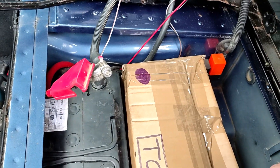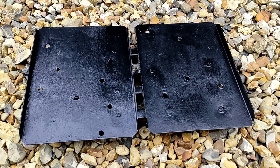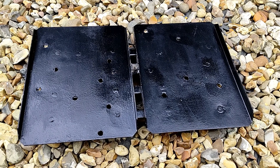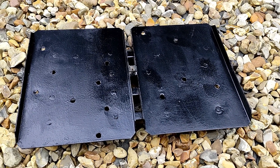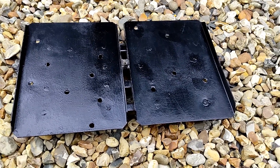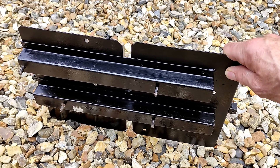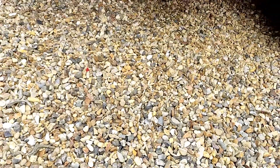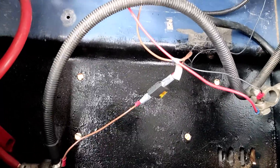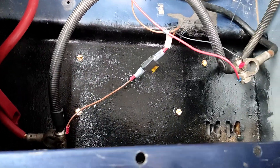My fake battery proves that with a bit of a struggle it is possible to fit the battery I'm hoping to use into the box. This is what I'm going to use to mount my dual batteries — it's been adapted from a wolf battery carrier, which I guess must have been used for the Odyssey-sized batteries. This is about 250mm long, which is significantly less than my battery, but the advantage is it's got two horizontal packing pieces and the bolts already in the right position to locate perfectly in holes that are pre-drilled in the bottom of the battery compartment. I'll just pop the battery carrier in.